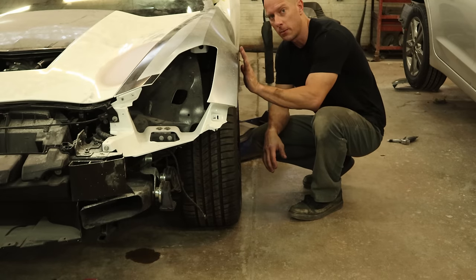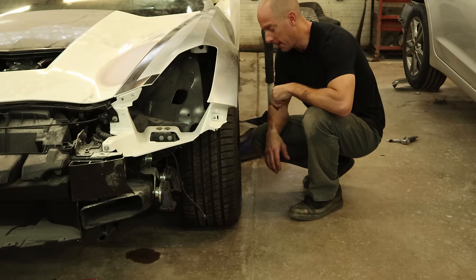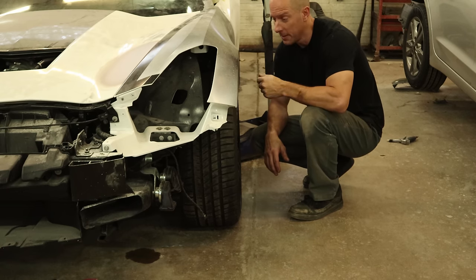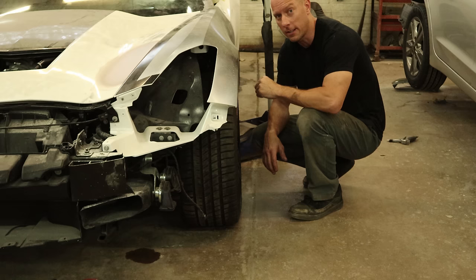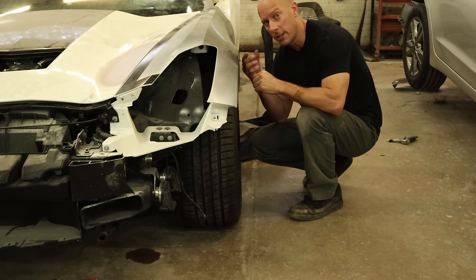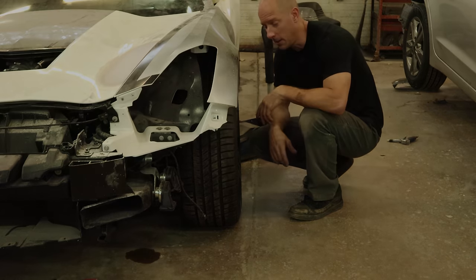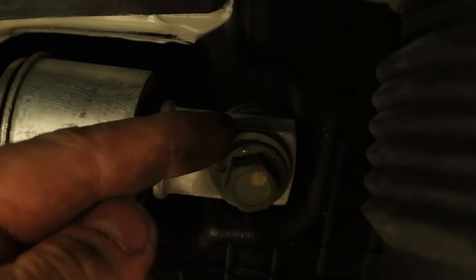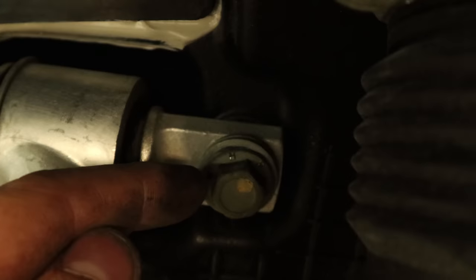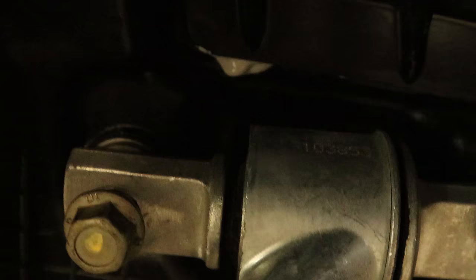So if you look, this wheel is in a little bit at the top. Because I didn't take it apart, I didn't put it back together the right way — I've got some washers that are on the wrong side of the control arm. We're just going to have to take the upper control arm off and put the washers on the inside to pull the wheel out where they belong. I checked the other side and that's how they go. You can see these two washers here — they belong on the other side of the control arm.